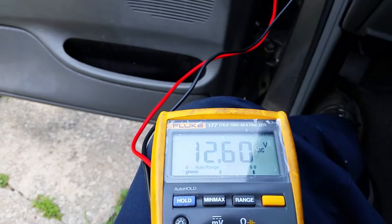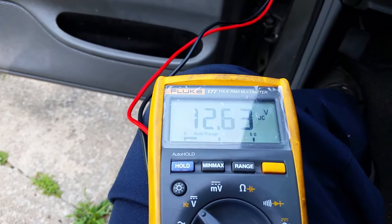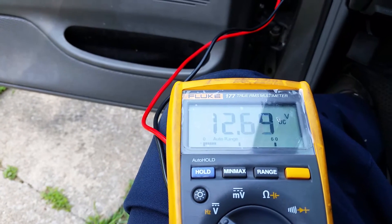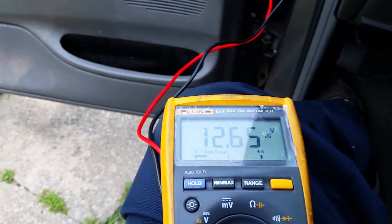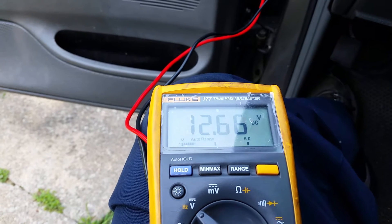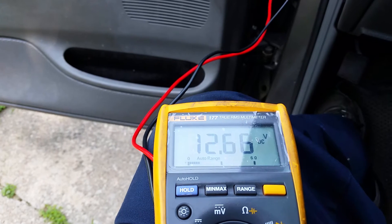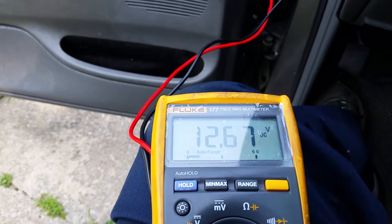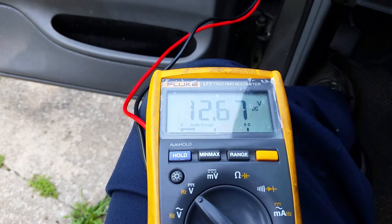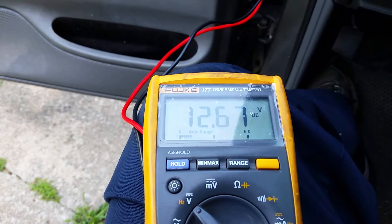There we go. If you noticed, the engine was cranking very well and the battery voltage didn't drop below 11 volts — so that's a good battery. Keep in mind that temperature matters too: as it gets colder outside you'll have less available voltage. During winter time if it's really cold out I usually go by about 9.5 volts. Normal ballpark figure I go by is 10 volts — anything lower than 10 volts during regular weather and that battery is starting to get weak.